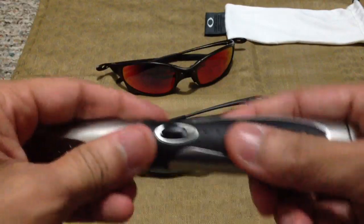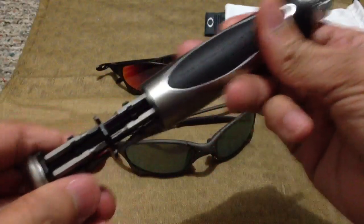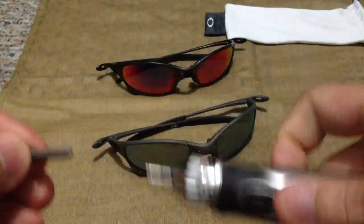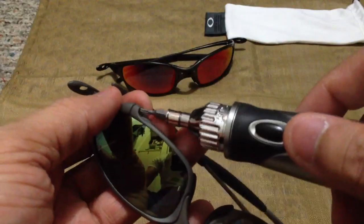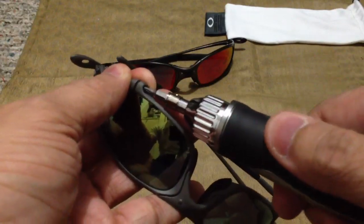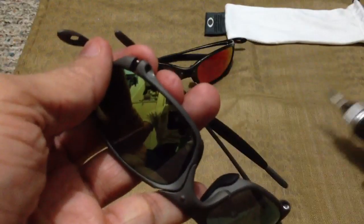Basically what you're going to have to do is get yourself a screwdriver — this is just a standard screwdriver where you can change the bits out. What you're going to need is a T6 bit for this, so just go ahead and find yourself a T6. If you guys don't know what T6 is, it's a Torx 6-bit, and that's it right there. First thing you're going to want to do is find the screw and start unscrewing it. Just be very careful when you unscrew it that you don't strip the screw — they are a little bit delicate and tend to strip if you're switching them out a lot.